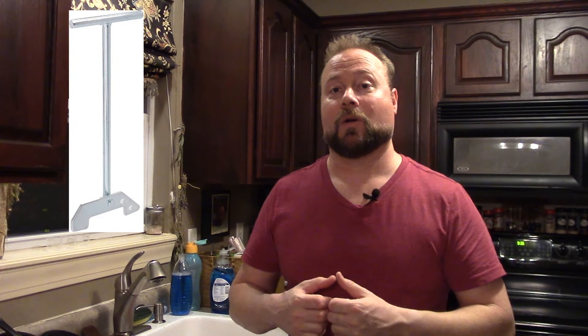Now, some of you might not even have that little hole in the middle of the bottom of your garbage disposal where you put the wrench. There are some garbage disposal brands I don't like, and the ones that don't have that hole are among them. There is a special tool — I'll have an Amazon link in the description below — where you stick it in from the top, get it onto the two paddle blades inside, and try to force it back and forth. It's not as easy or handy as the Allen wrench at the bottom, but it's another option.